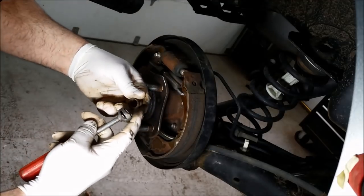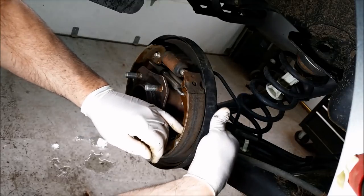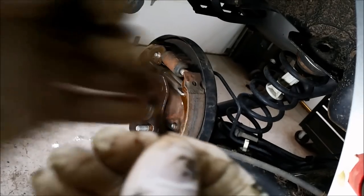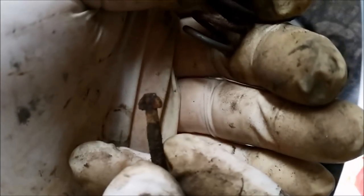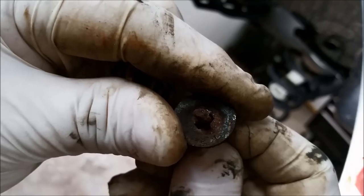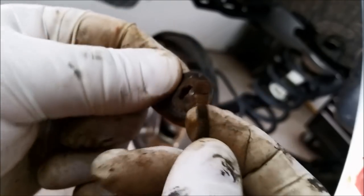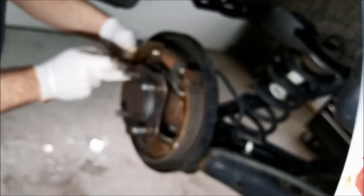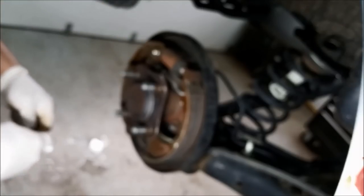Nice and crusty. It's got a little mushroom tip on it that fits into this little piece right here. That's all it is — you're pushing this down, compressing the spring, turning it, and pulling it back apart. These things can be terribly corroded or rusted — they sell hardware kits. These aren't too bad; I'm going to reuse them. This is a family member's car so I'm not afraid to save a couple of dollars.